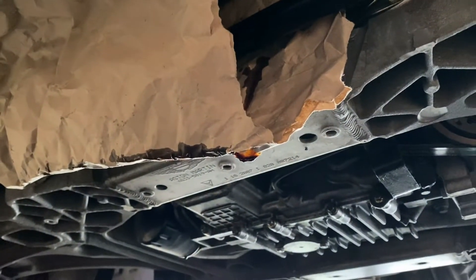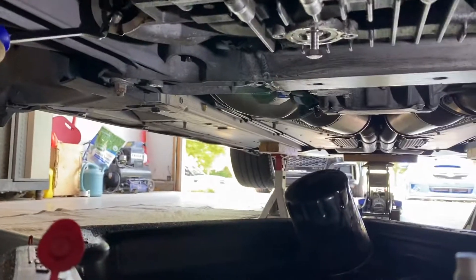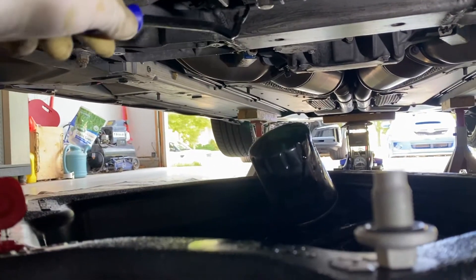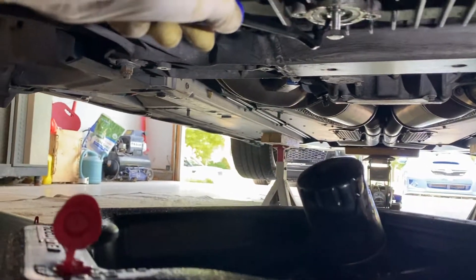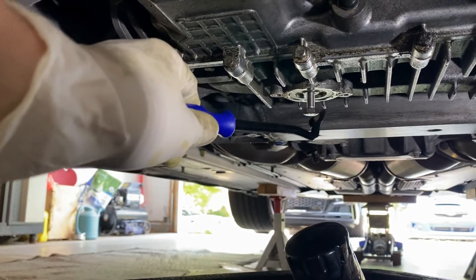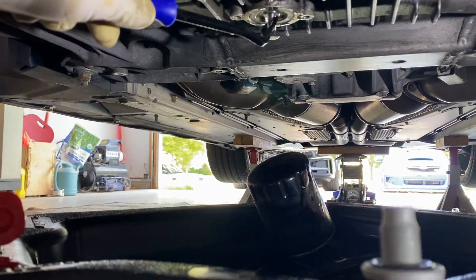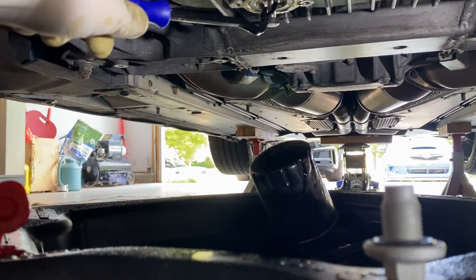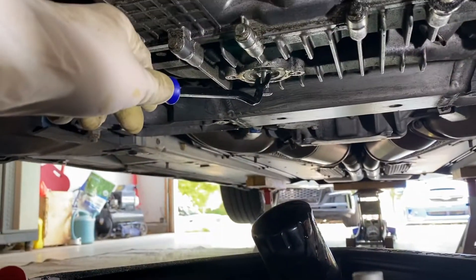At this point I've got the oil filter off. I've taken the cover off this bypass filter here and I'm going to gently pry that one out. You'll see there's a second one further back, but this one I've done. Just got to get it out, clean it with brake cleaner, clean it all up, and put it back together again. Good opportunity to check there's nothing being caught inside.